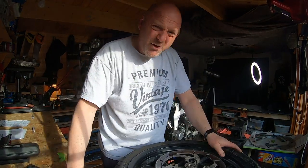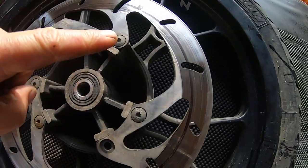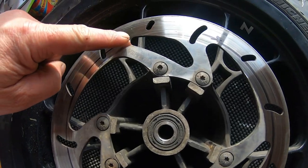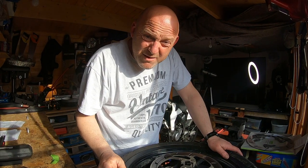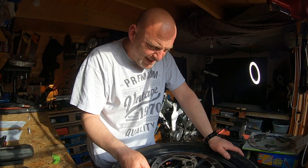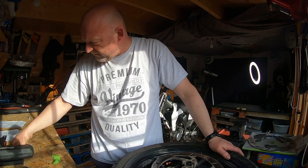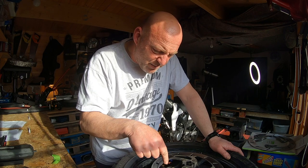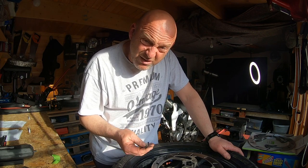The wheel is off. I'm going to quickly show you the marking — you can see here where it's a really thick pen mark and then it gets lighter and lighter. That's where I took the pen off. So I'm pretty sure this is what causes the pulsating. Let me just take this off and see about extracting this bolt. I've got these little bolt extractors. I need to drill into the bolt — center punch it first, drill into it and then reverse-turn it out.